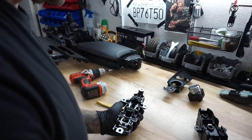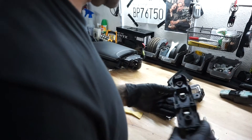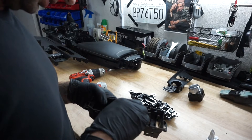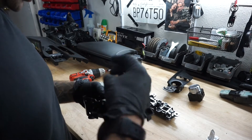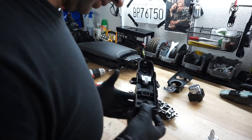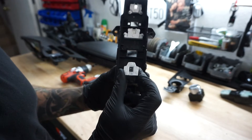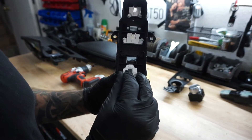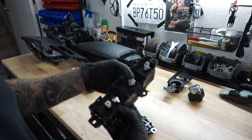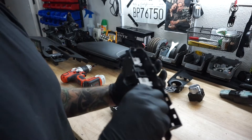Take this and lay it face down. Don't lose the manual button because you'll obviously need that. Now these pieces only go in one way. These are the pieces that came out from the shifter — the black tabs. Just put those back into place and leave them for now. When you have the buttons, they come in from one side and each one is unique — they only go in one way. Once flipped over, you'll see where each goes: that's your park, that should be your drive, and that's your manual button. It only goes back together one way — that's all that matters.